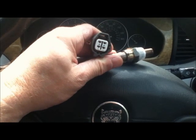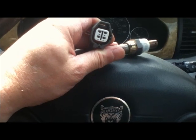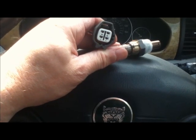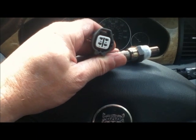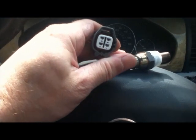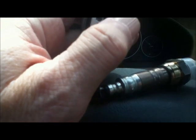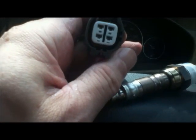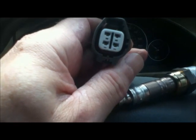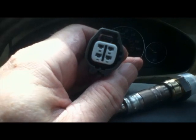One of the lessons I've learnt doing this job is that the sensors have different connectors. So the one that I've just fitted is the wrong one. I just ordered an oxygen sensor from eBay not realising that these things are actually handed. The way to tell is if you look in this fitting — on this side there's two little cutouts, but on the one that I've just fitted, those two little cutouts are on the other side, so you can't connect the electrics up. Well worth knowing that.